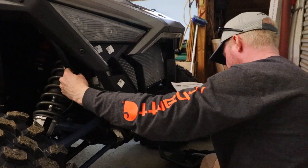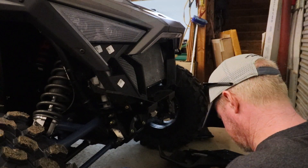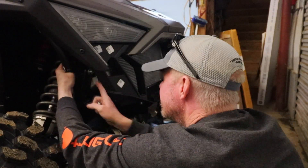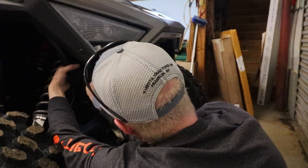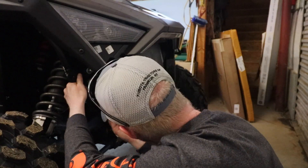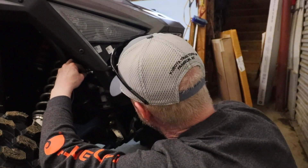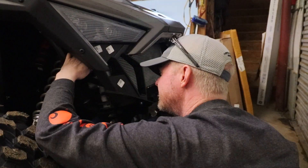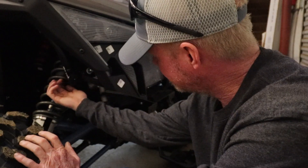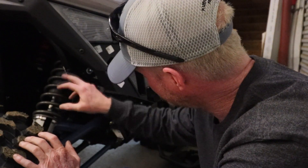This uses Allen head bolts, a washer on each side, and two nylock nuts. So that's kind of how it looks — the bumper will go back and there'll be a screw that goes through the other side of the bumper. We'll do that on both sides and have these tabs mounted, but the bracket gets sandwiched between the fascia support and the frame mount itself.